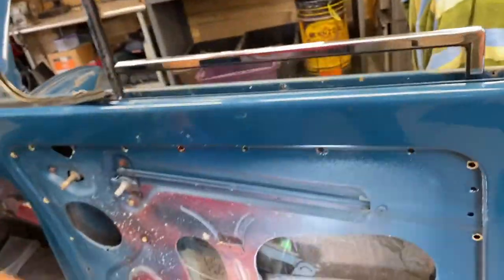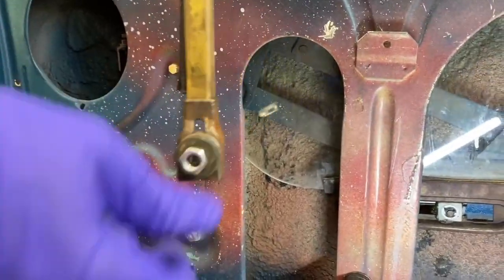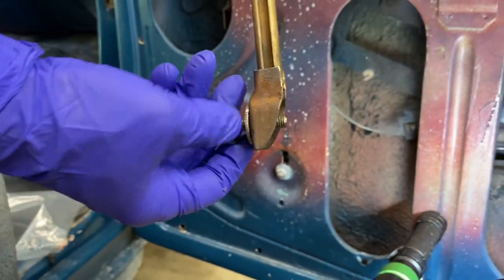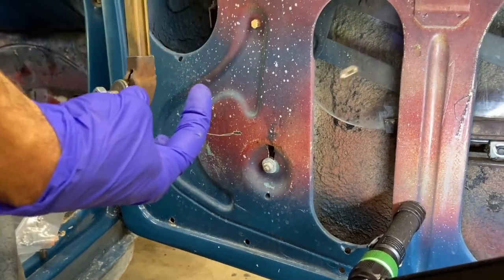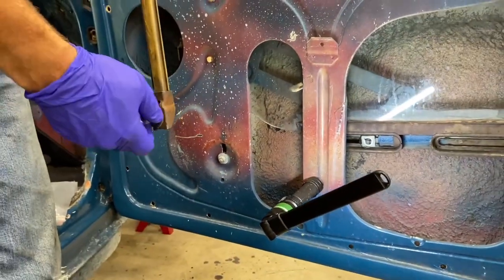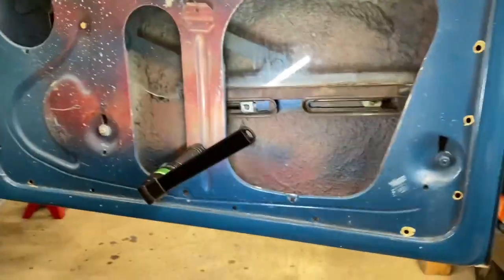On the inside there's another bolt. What you're pulling out is something that looks like this — obviously it's a mirror image. This part is a little messy: there's a bolt in the door, but actually it's a threaded rod — a stud, not a bolt — with a jam nut instead of a head. The stud is turned farther out than you'd be able to pull through the door because the door doesn't have enough thickness. That's why the end has a standard slot so you can screw it in, allowing you to pull it through, twist it sideways, and get it out. That requires the glass to be gone, and it comes out the top once the stud is out.